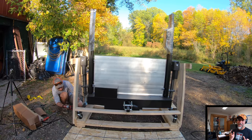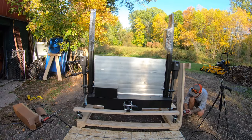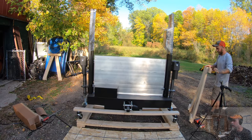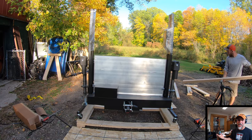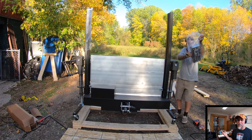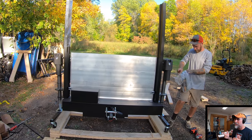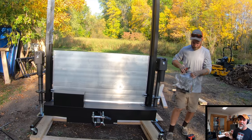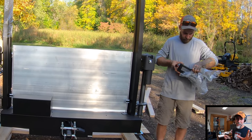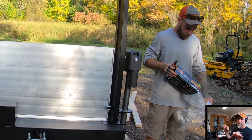So it doesn't look too bad yet. What this is — this is a lift gate for a pickup truck or a van. And I had this aha moment: maybe this could be the solution for guys that are trying to eliminate a trailer. We're going to find out how this actually works. What Sam is opening right here is a battery charger for the unit itself. It's self-powered and you charge it up using this Duracell trickle charger. It attaches right into the back.